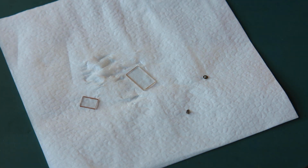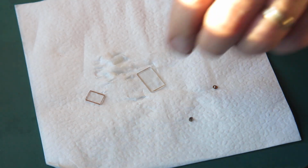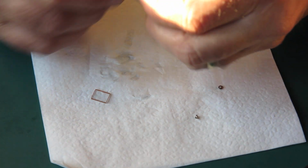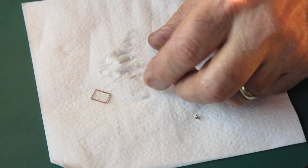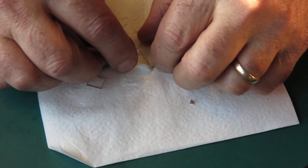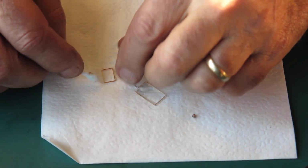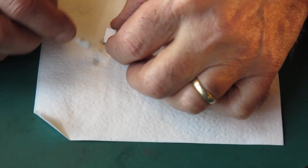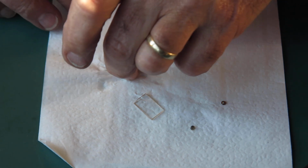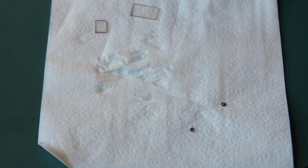It's not unknown, not so much with these cameras, but certainly with the 3Cs and 3 big C cameras and related models, with the large pieces of glass on the front and the finders. They have a disturbing habit of leaving here in one piece and arriving on the other side of the world with the glass cracked in two, and it'll be just because the design of the mount is such that they're under an uneven load. They're not held down all around the perimeter, they're held down in one or two spots. A change in temperature, camera gets a thump. Who can say what causes it, but it doesn't take much.